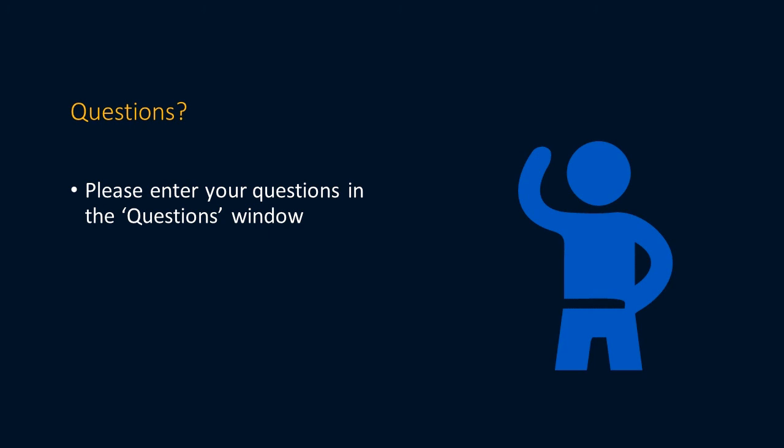So my recommendation there, the way I'd answer that question, is I would be less concerned with signal interference coming from devices like other electromagnetic interference, and I'd be more concerned with the physical objects that you've got between the two wireless points. And obviously the way you avoid that is by putting the device itself up high, get the antenna as high as you can, and trying to make sure that you're going through as wireless-friendly materials as you can.